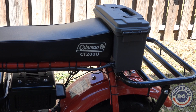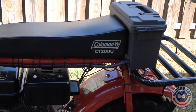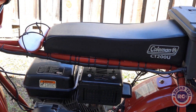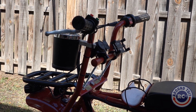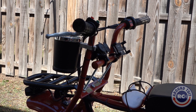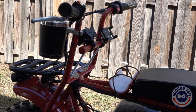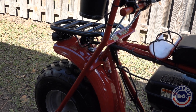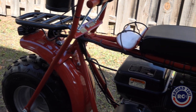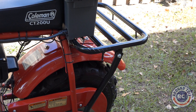If you notice under the seat, there's a cable that comes out of the ammo box — that's all your wiring that goes to everything on the bike that requires power. If you follow it, it goes underneath the seat all the way up to the front of the minibike. Some of it goes to the switches for the horn and the light, some goes to the USB power station and the 12-volt accessory port, and then you have some that goes to the headlight, the horn, the ground light effects, and the tail light on the back.